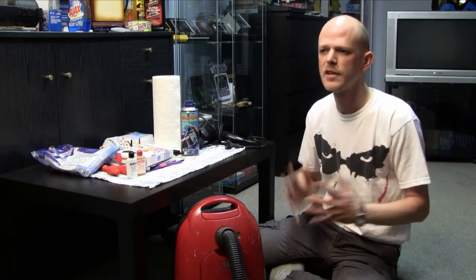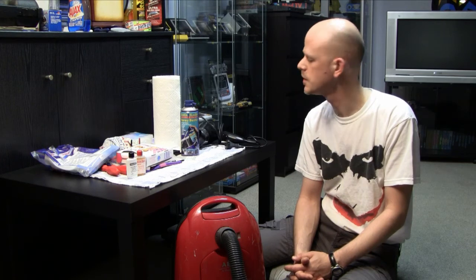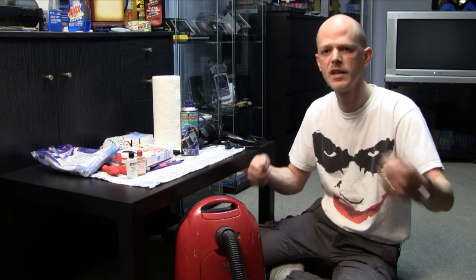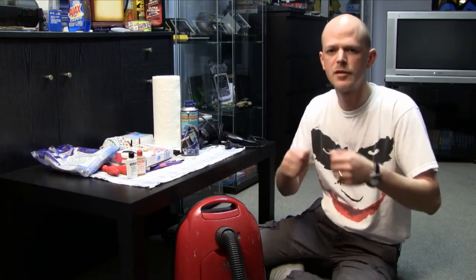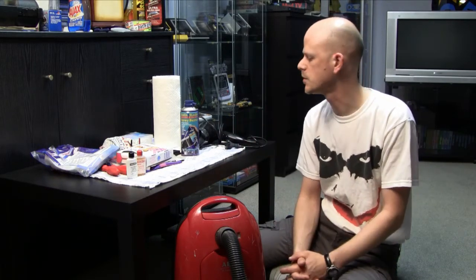And the hairdryer I mostly use only on old scotch tape, which you can find sometimes on old game boxes. And also for some stickers and price tags, I also use the hairdryer. And also to remove other tapes like duct tape or anything, because a lot of times you may find a box of a video game system that people tried to seal up, basically to close those boxes with duct tape or packaging tape or whatever, and this is the reason why I use also the hairdryer for my cleaning of video game systems and everything.